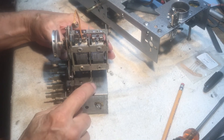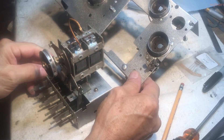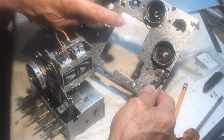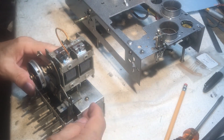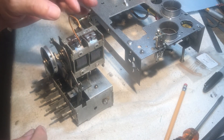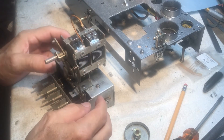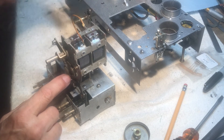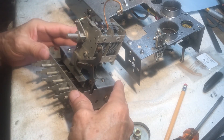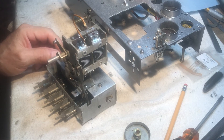There are two screws on this end and a screw on this end — those three hold the push buttons in. So what you do: remove your wires to your tuner, remove the drum, remove the link on the upper portion, swing it out of the way, pull your screws, pull your tuner, and then you can take these screws out of the top and drop the push-button assembly out through the bottom. Simple. Thanks for watching.